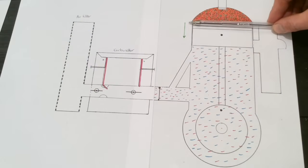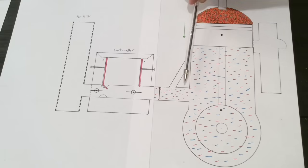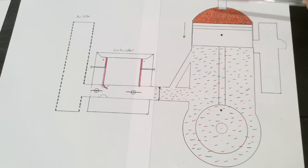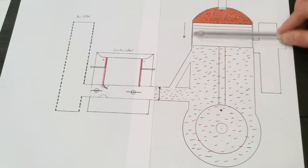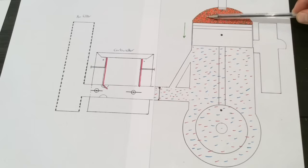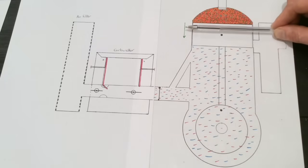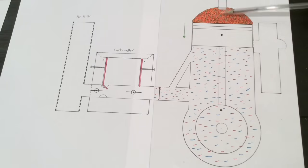And then the air and fuel mixture is compressed, the spark plug ignites again, the piston's then forced back down by the explosion, and the process then continues. It's important to know that a two-stroke engine combusts and fires every time the piston rises — so every time the piston gets to the top, it combusts and fires. Whereas a four-stroke goes up once, fires, comes back down, comes back up to force out the exhaust smoke, comes back down again, then goes up and fires. So it fires every other on a four-stroke, but every time the piston rises on a two-stroke.